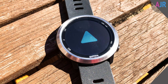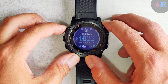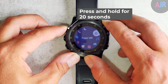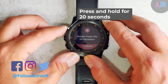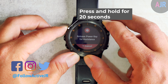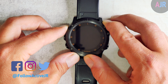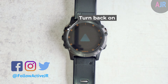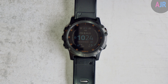The next method is if your Garmin watch is stuck on the Garmin logo screen or it's unresponsive. To do this, you simply hold down the button for 20 seconds. If you're following this procedure in real life, an assistance message may come on — just simply ignore it. After around 15 seconds your device should switch off, but continue to hold. Once you've done that, press the power button to power back on, and your device should reset. This will fix most problems where your device is unresponsive or stuck on the Garmin logo screen.